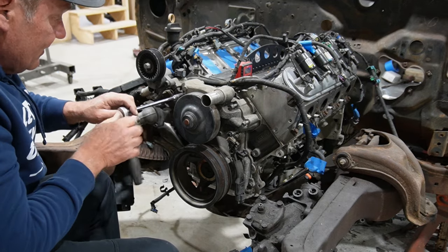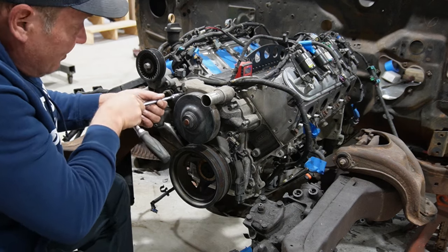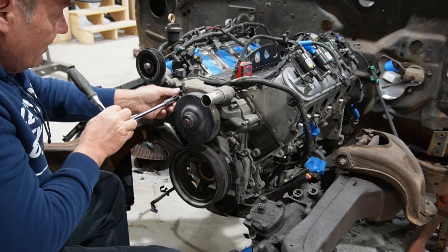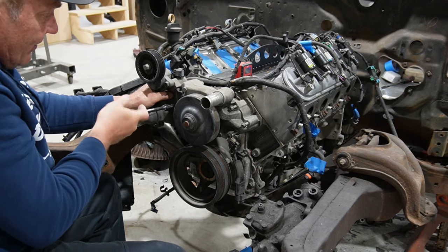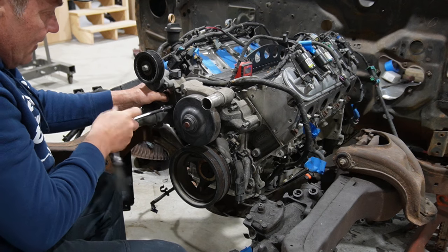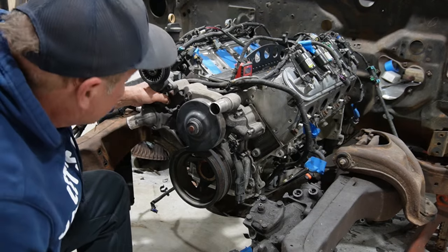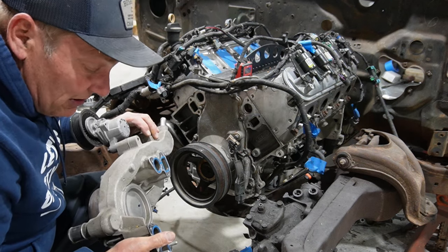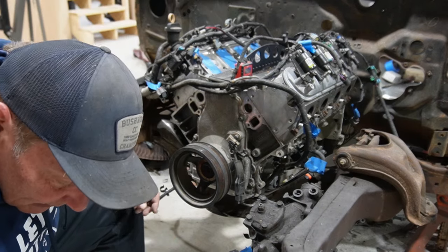I got most of that from searching on the web and doing a little bit of jungle shopping, and that way I think we can at least make a reasonable attempt at getting everything attached to the front of this beast without spending more than absolutely necessary. So this water pump is pretty straightforward. The idler pulley is already attached to it, and it comes off with just 6 bolts. They're supposed to be reusable gasket material, so they don't need the silly putty stuff, but I got some new gaskets anyway, because I don't want it to leak. Except it just leaked all over the floor.